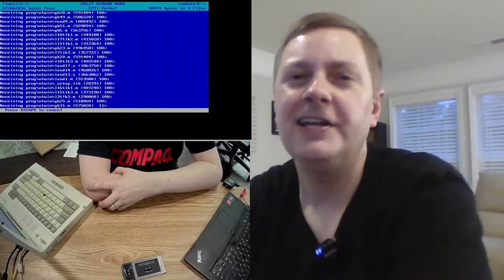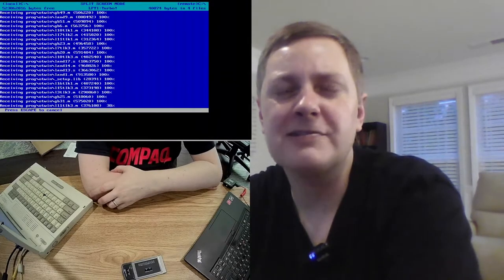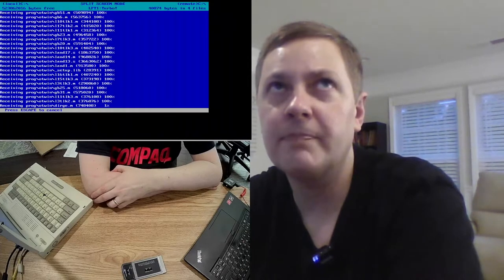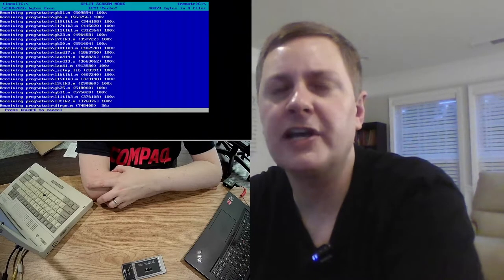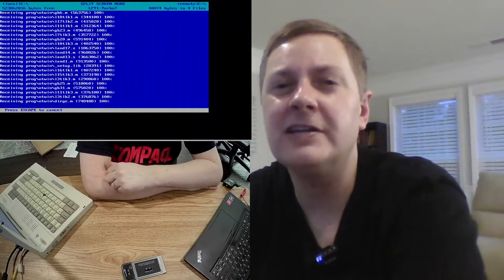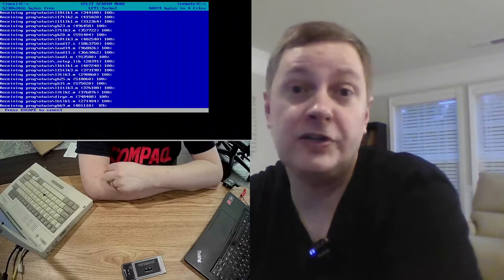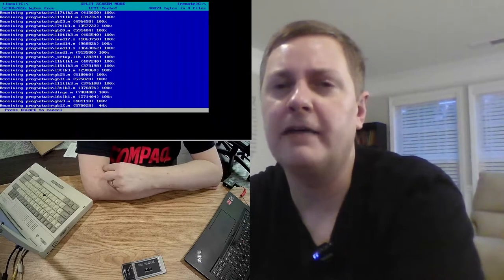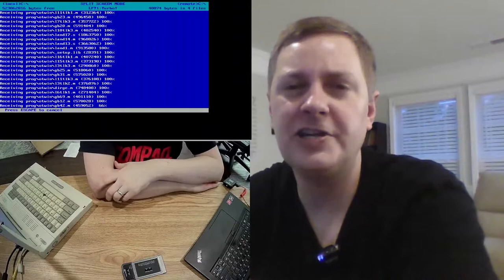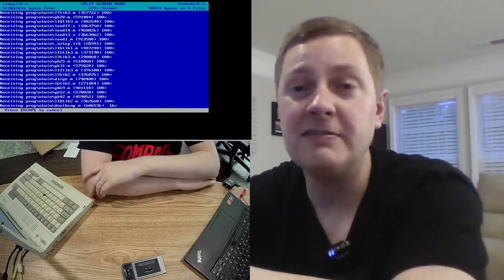Sort of like EGA. Yep, EGA with a little bit worse dot pitch, I found. Unless maybe somebody makes a really high resolution CGA monitor. I don't know if it's the video standard. I guess I could figure this out by using one of those CGA converters, just to see if the video quality gets better. But every CGA monitor I've seen, and even for the 1000, I've got a CM11. That CM11 has a good dot pitch for a CGA monitor versus, say, a CM5 that came with the Tandy 1000 series. It's just not as crisp and clear as an EGA or VGA monitor. So I don't know if that's the video standard, or the dot pitch, or the limitation of how many dots you can have with CGA when forming the characters.